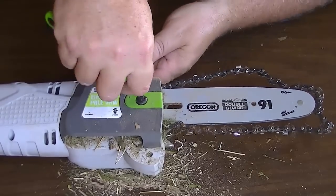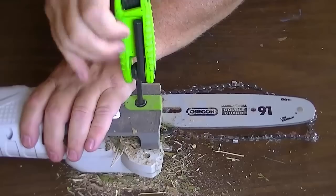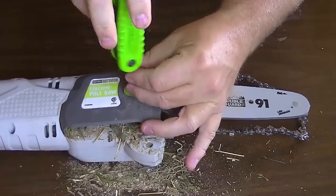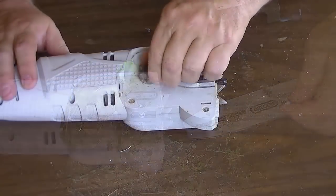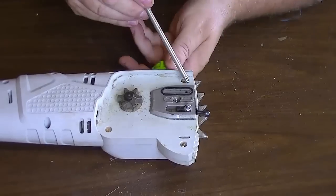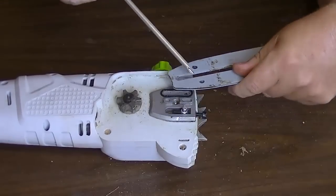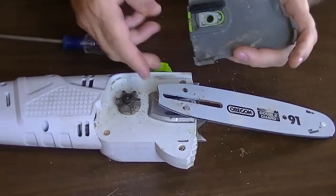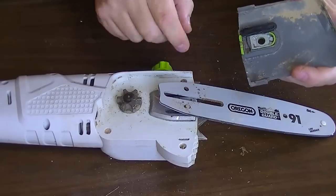Sure enough it is — a six, it fits, and it's working, so that's what we're going with. First thing, let's make sure the chain's not broken. Obviously it's not — I don't see any damage. Everything turns free, no damage. The oil looks like it's supposed to pump out of that little hole into that point of the bar. There's a seal on the cover that closes that part so oil doesn't come shooting out the other side.